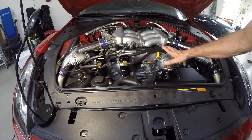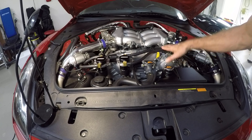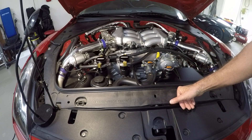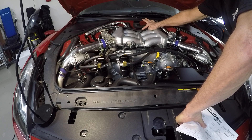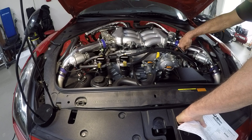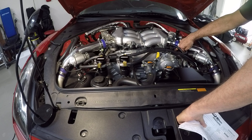They're going to send you a bunch of tubing, but not enough for everything — only about half of what you need. Go down to the auto parts store and buy three-eighths fuel line tubing to complete the project. You're also going to need a T-fitting at the rear — a three-eighths T — and two more three-eighths T-fittings at the valve cover exits where the lines will have to be split.